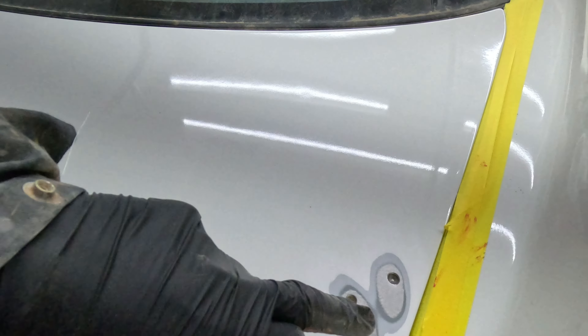To use this we're going to fill these holes. One thing to mention: try to keep things flat, because if you have a low spot you can always fill it in. If you have a high spot, sometimes you can't sand it down and get it level. We're going to add a little bit — probably a teaspoon between all the holes, maybe not even that much. We're going to let it cure for about 90 minutes and then sand it down.